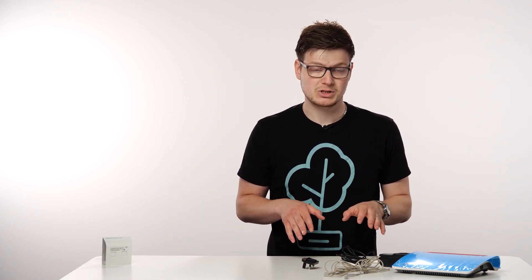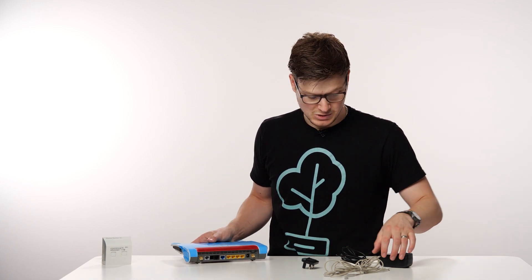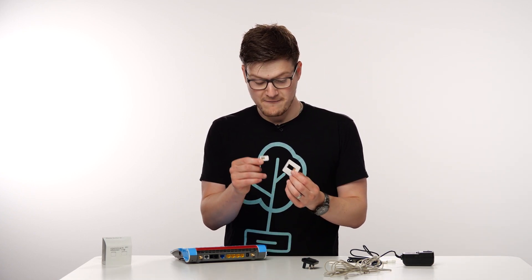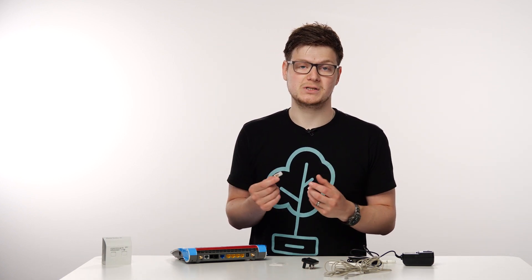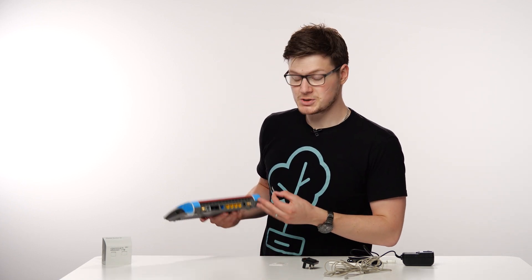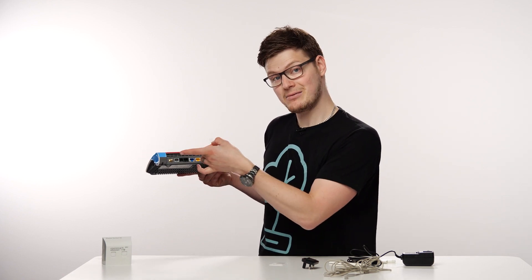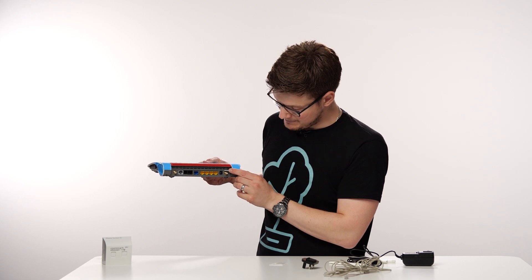The first thing you want to do is install the SIM, and the reason for that is the SIM slot you'll find here is obscured by the antenna. So first things first, get your SIM and pop it out. Now you want a full-sized standard SIM — you don't want a micro or nano SIM that a lot of us are used to with modern phones, you want the full-sized SIM. Then you want to put this with the chip side pointing down so the dint is on the left-hand side. If you're unsure, just look at the diagram. Slot that in and you'll hear a little click and then you know that it's in.